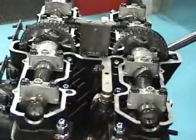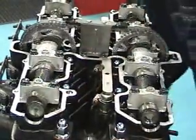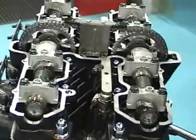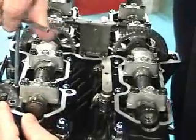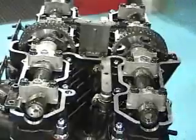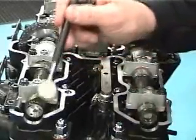That's going from a 7 to a tight 8. Now if I want to adjust this down to a 5, you're going to rotate — these buckets are slotted on both sides 180 degrees out — so line this little slot up so you can see it up in the front. Rotate your motor over and it's going to compress. Use this tool to hold down your buckets. Push on this corner to make sure everything's square, snug it up, and rotate your motor back. This holds the buckets down in place, compressed, so you can pop the shims out. Use a little flathead screwdriver, slide it in the slot, pop your shim up, and pull it out with a magnet.